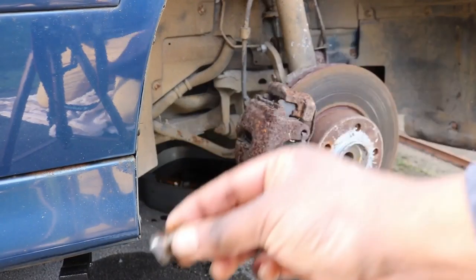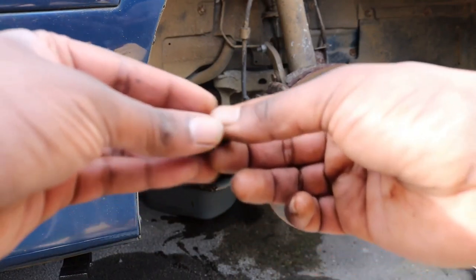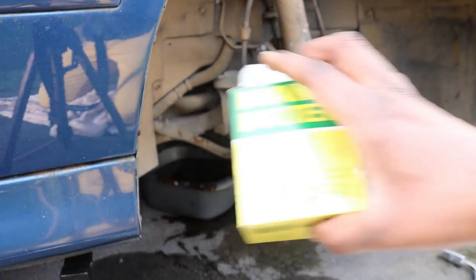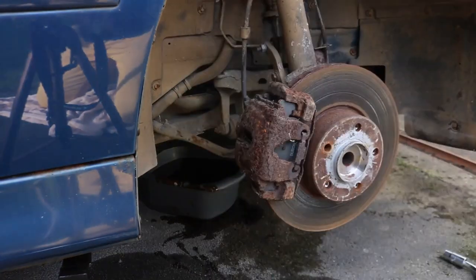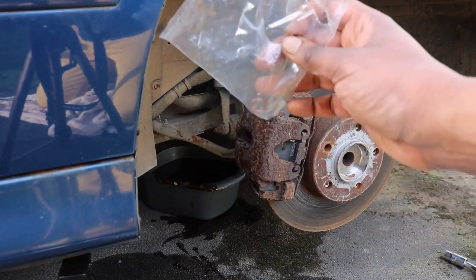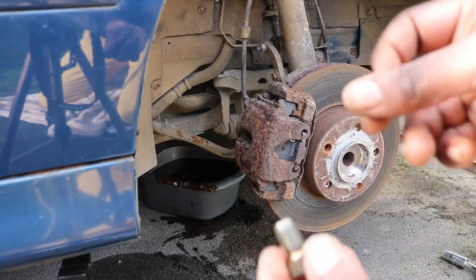So on the screw for the oil drain, there is this washer that you need to remove, and in the box that came with the oil filter you have a replacement ring or washer that you need to install before you return the drain plug screw.